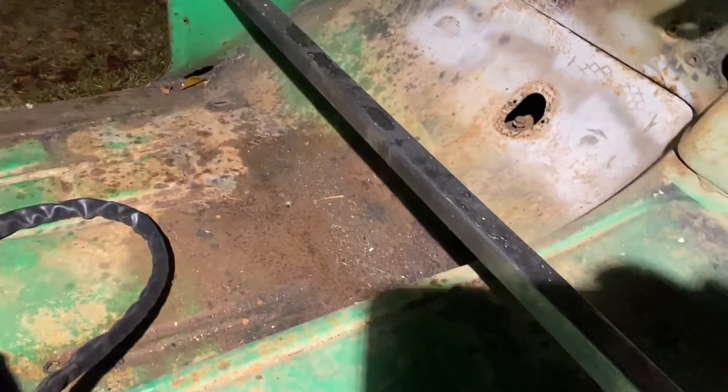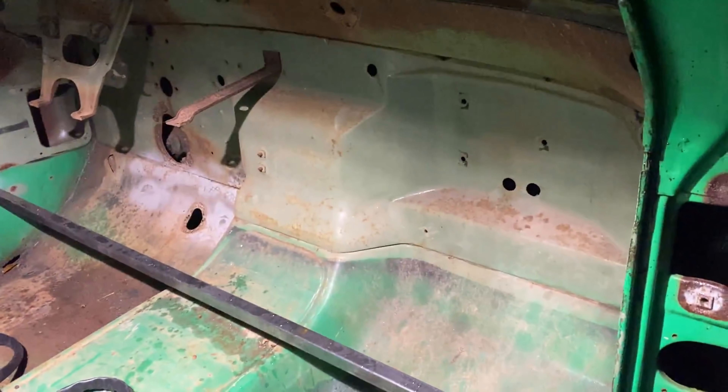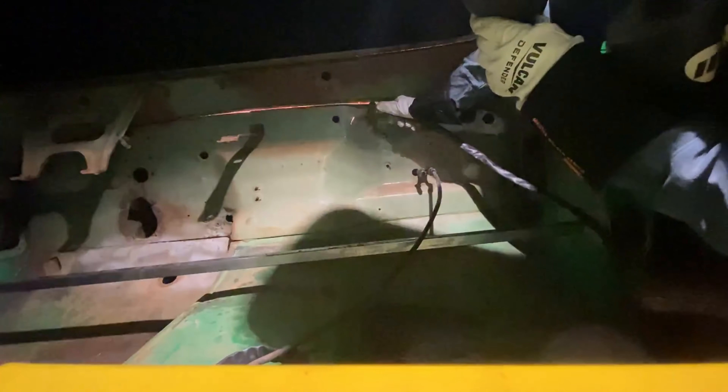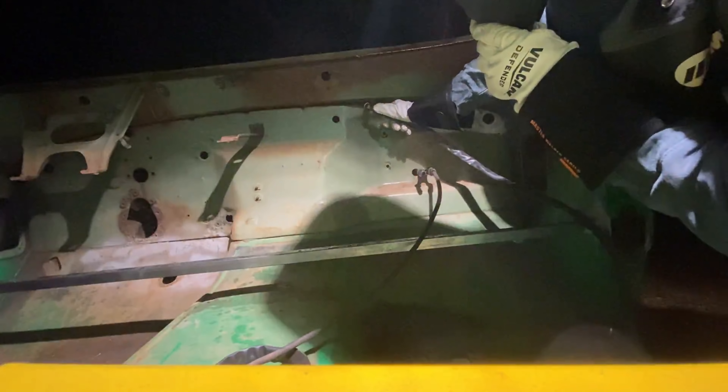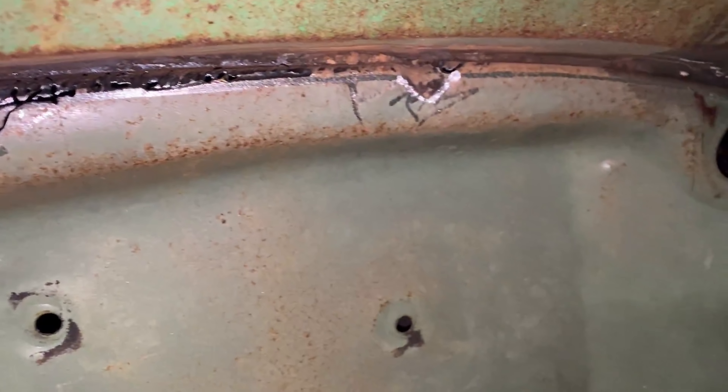I got all the tools out trying to figure out the best way to cut these. I ended up just sawzalling the whole bracket there close to the cab, and I took the little body saw over there and got the rest of the plasma cut out of the way, so I think she's holding on by a thread. That's the original '71 dash out. Checking how my little spot welds held up — seems still sturdy. Good access to the firewall now. I'm not sure exactly how much I need to cut out but I'm pretty sure all of this needs to go, so I'm going to start cutting and see what I can get done.